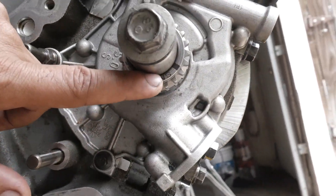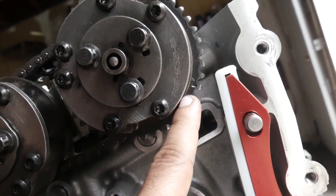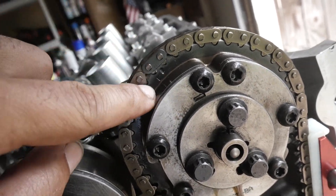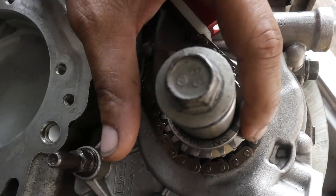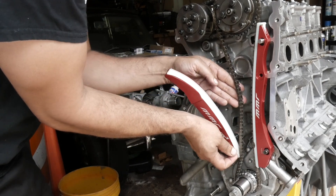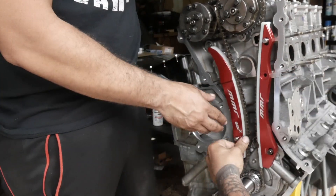We have the notch that sits on here and then also if you look at your gear, you have one that says L and another that says R. These can be on either side — driver or passenger. On the passenger we're going to be using the R, but on this one we're going to be lining it up here with the L. We had to turn this a little bit and put some more tension to it, but we did get everything lined up the way we needed to. As you can see, we have our darker link lined up with our L, and if we go down here we've got this lined up with our notch. So we're good to go — now all we have to do is put our other piece on here and then slide the tensioner in. We're going to go ahead and put our other guide on here, just slide this thing in place. There we go — voila, exactly how we thought it would go.